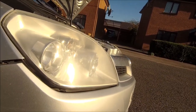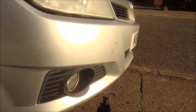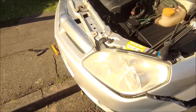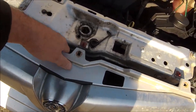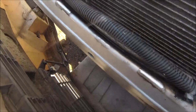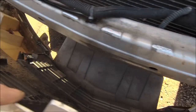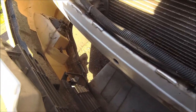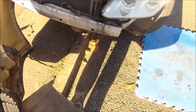There shouldn't be a lot holding it in now. I need to pop the other side off — I know there are wires behind here that need disconnecting, so you've got to be careful. That side popped off just the same. In theory we should pull these off here — my whole front should, and it does slide out. There's a sensor down there and some wires connected to the bumper and obviously the fog lights, so I'm going to get that all disconnected. On closer inspection it is just the one plug on the passenger side.